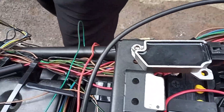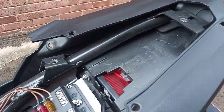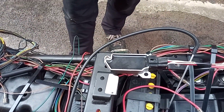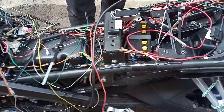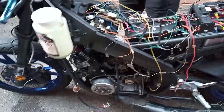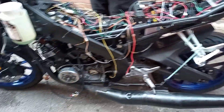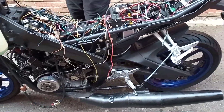We initially had it bolted down at the side with an earth to the frame, then had it in the back rattling about and it wouldn't charge the bike. Originally they have an earth on the F2, F1, or the RDR - but since it's back on the frame, we have voltage again that rises when we rev the bike. That's it for now - we'll tell you a bit more on Sunday when we do some pipe work with Phil. Thanks for watching - dilly dilly, need a beer!